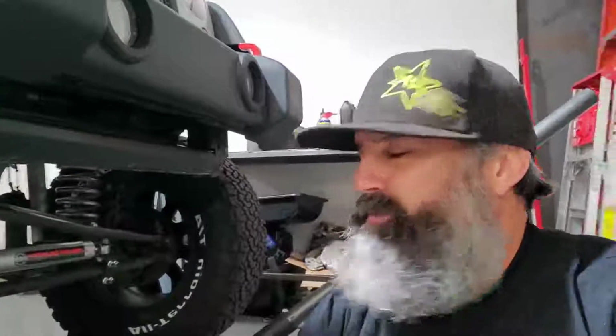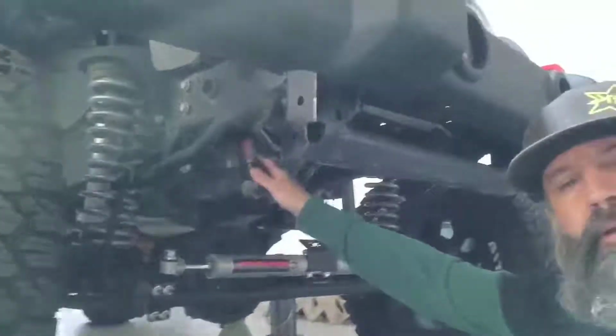So that's what we're doing here at the shop. That's a quick little tip. One, the aluminum steering is not the greatest. Especially if you have hydraulic steering, you can turn your wheel and just see the thing bowing. Not a big fan. And the pitman arm drop, you really need to go back to the stock to be as easy as you can on that sector shaft. And there are mounts that will bolt up to where your steering box bolts up that will support that sector shaft as well. So that's what we're doing down here at Stacked Off-Road, we're kicking butt and taking names.